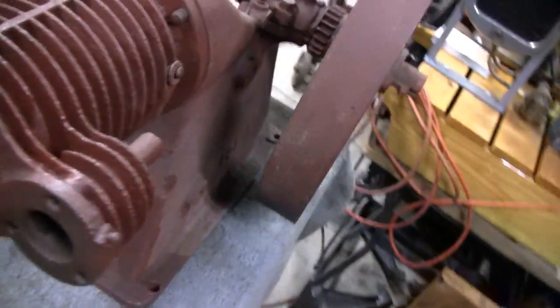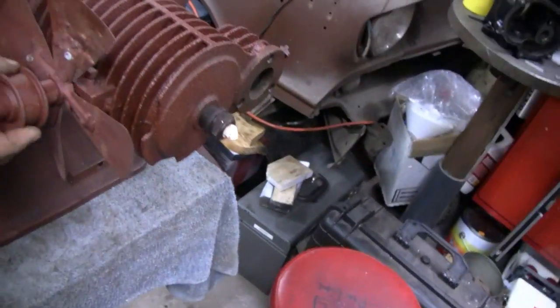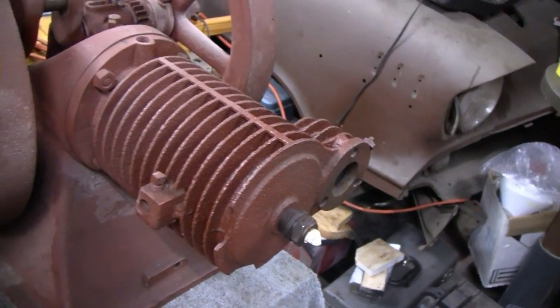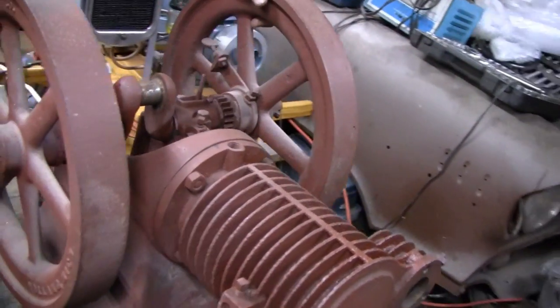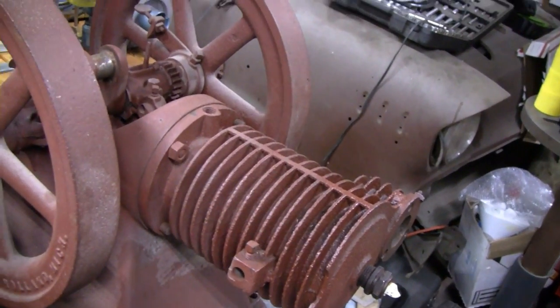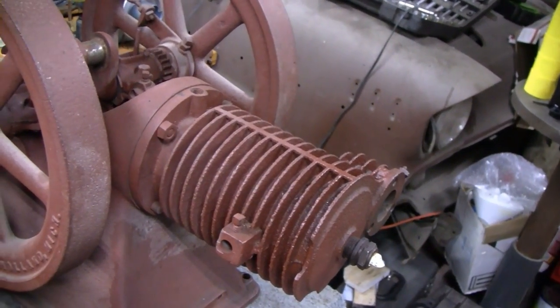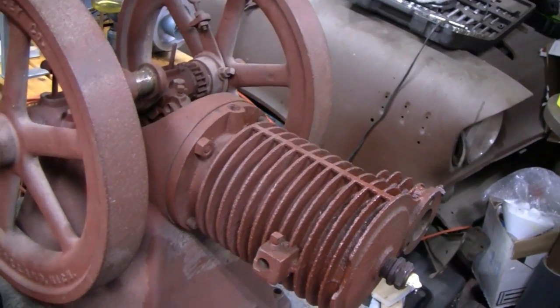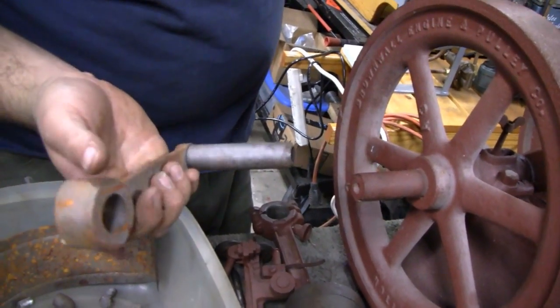Yeah, that's another thing. This is air cooled. This doesn't have a hopper. Right. They did make hopper models of this though, Mike. But this one was the air cooled, so that's why the fan. It seems to be rarer. I see all kinds of water hoppers around, but seldom do you see these. Mike was telling me he thinks that when they went out of business, or they sold out to Ideal, the Ideal Lawnmower Company, they carried on the air cooled engine with those mowers, a little hit and miss. And you can see some similarities, like in the governor setup and the latch out. So I don't know how much of that actually crossed over, or if they just built their own engine from scratch.